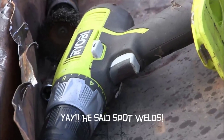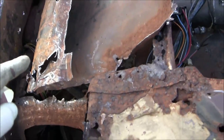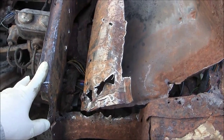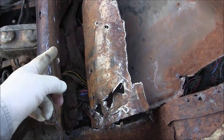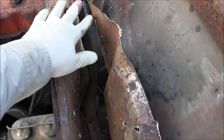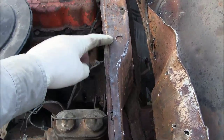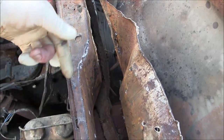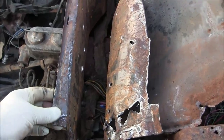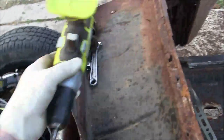Getting to the spot welds further down the firewall was a lot of work. So over here I gave myself a little more access and went quicker. I still need to come in and cut this edge off, but what I did is I took my air chisel and hugged right up against the firewall with my chisel pointing that way - basically cut this loose. Now I'll be able to come in with a flat chisel. I've got a lawnmower blade that I sharpened and thinned out so I can get under here and beat it with a hammer to pop these rivets loose. Works a little better, a little more control than an air chisel. That's it for the upper cowl assembly removal.